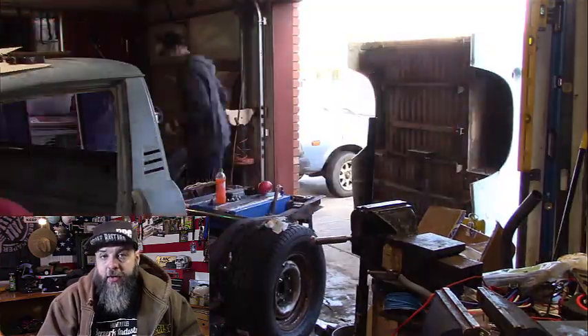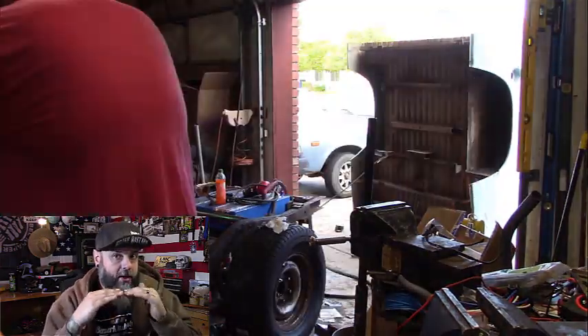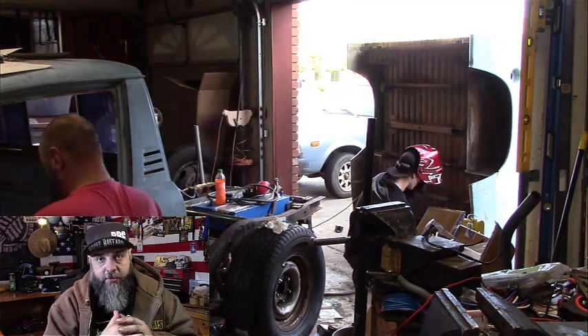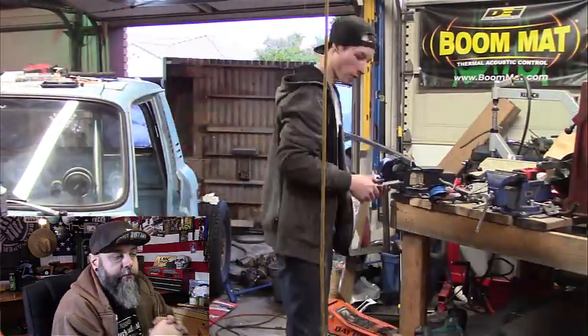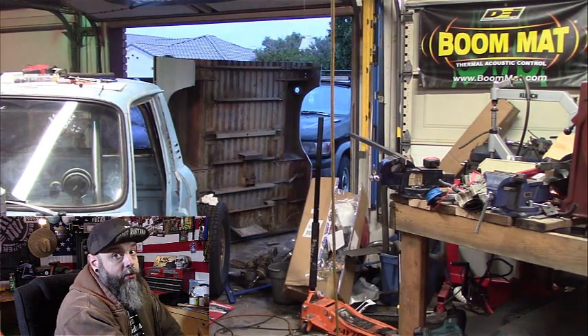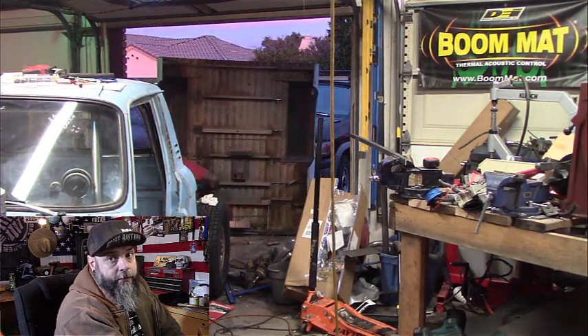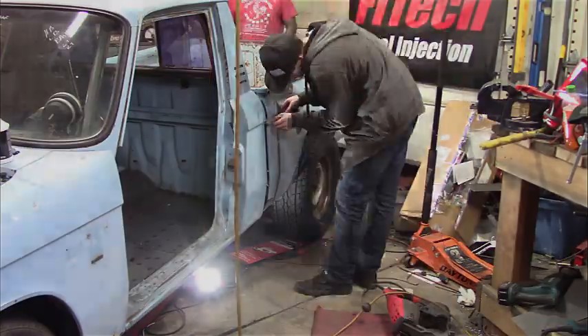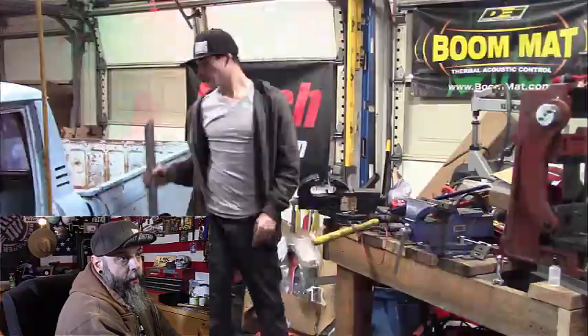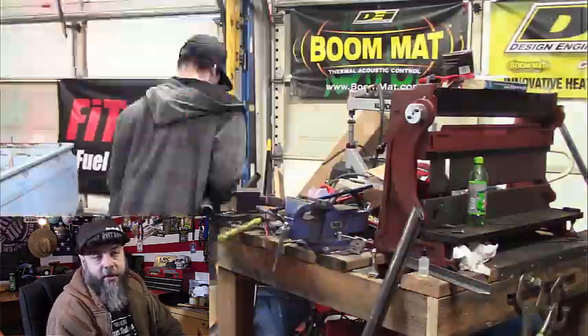Wayne got some new RTV, and I had Austin start working on cutting the bed mounts off the bed. When I shortened the frame, I had to kick it a half inch, which throws off all the bed spacing - so he's cutting all the mounts off so we can rework new mounts to bring it down that half inch and get it squared up. We also had to plasma a large hole in the bottom of the bed for the fuel cell. The bed is just tacked on while we figure out exactly where to square it. Meanwhile, Austin is cutting hip bars for the sides of the cage.